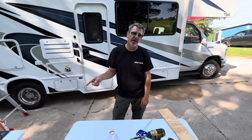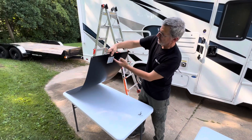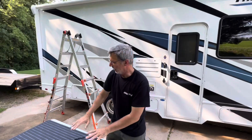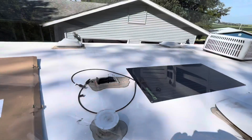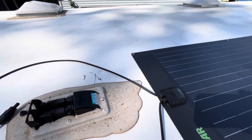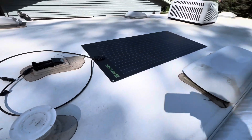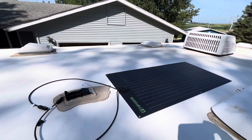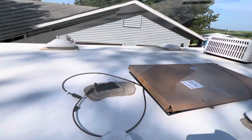The first step: I'll get on the roof and show you where I'm going to set this. I actually want to plug it in to see if we're getting charge to make sure it works before going through all this effort. The instructions on the back say it's 100 watts and to cover it before plugging in. I've got a piece of cardboard to cover it, then I'll plug it in and remove the cardboard. Here's the roof of the RV — you can see the factory-installed solar connector with matching connections. First, wash the roof where you're going to set it, because once installed it'll be covered forever.